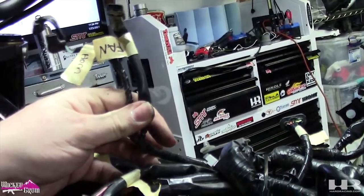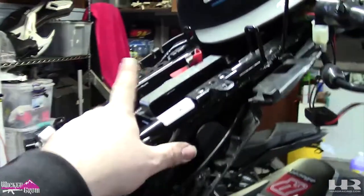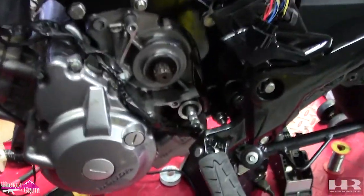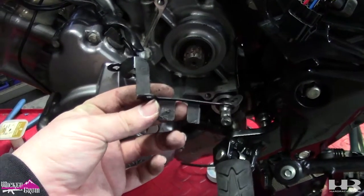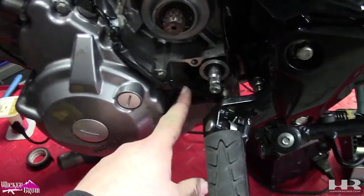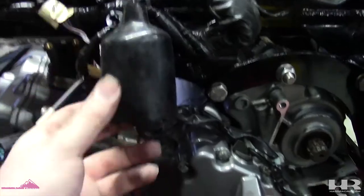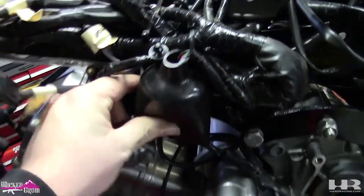Fan probably shouldn't have to extend, since the fan is going to be right here. The horn is going to reach right here — perfectly fine. We got the battery cable that's already up here, perfect location. I have a grounding cable I haven't put on yet which will go from the ground to the grounding side on that side. I took off the kickstand switch bracket — I took this off and just routed the cable with the cable that's already here, zip tied it together. It all bundles right here, zip tied to the main harness, and it should just stuff right in behind the plastics.